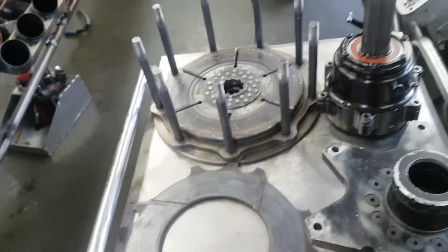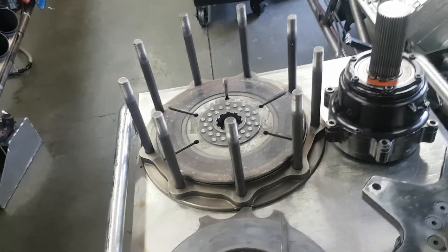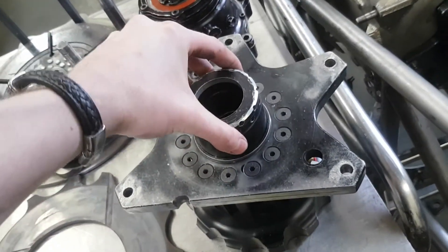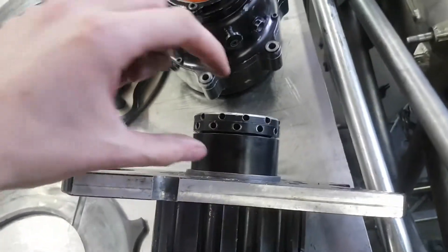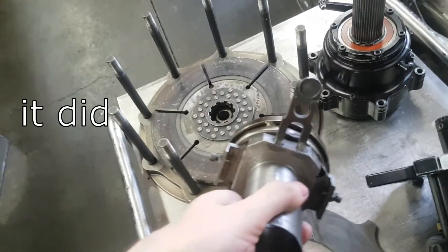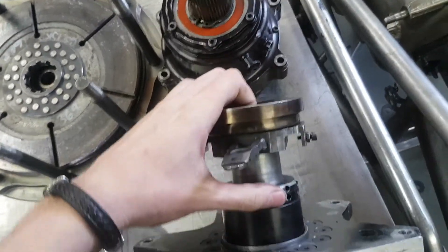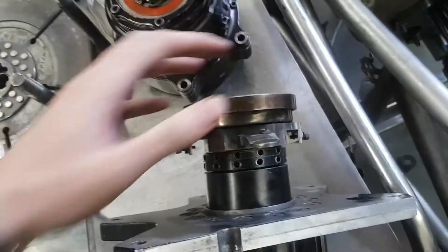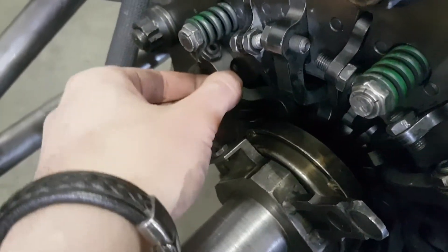I'll talk about how the stands work in the next video — I'll go a lot more in detail about the pressure plate and the hat that sits on top. The next piece to talk about is what's called a cannon. The cannon is essentially a giant hydraulic piston. This piece here sits inside the bell housing. We have a release bearing that sits inside the cannon, and as the cannon goes in, the release bearing will go in and restrict how many arms deploy.